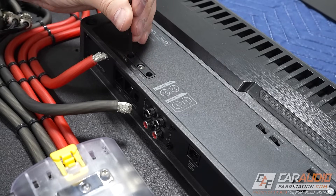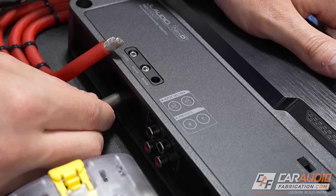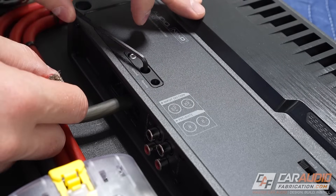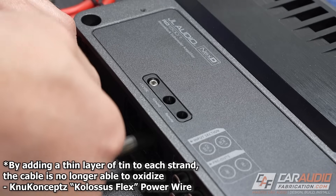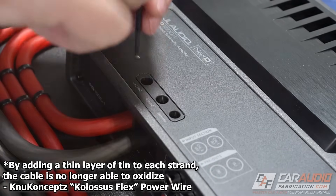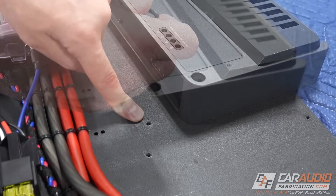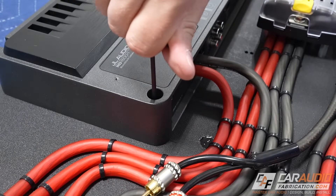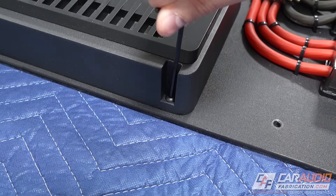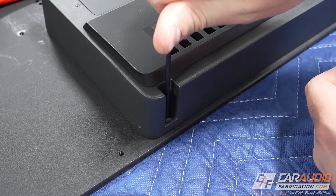Something I want to mention while you're watching — this is not aluminum wire. This is in fact OFC oxygen-free copper wire, but it is tinned, which is why it has that silver color on the outside. Just remember, you can't judge wire based on how it looks, because CCA — copper clad aluminum — is in fact copper colored on the outside. I'm going to add those 10-24 fasteners to mount this amplifier in position. I didn't use ferrules on the power wires because of the design of this amplifier — the way it clamps onto the wire is not a set screw style terminal, so we're not going to use ferrules here.